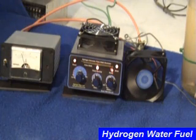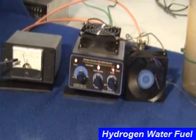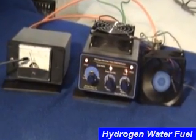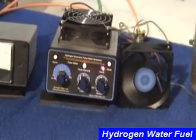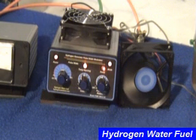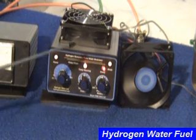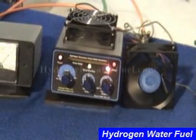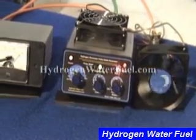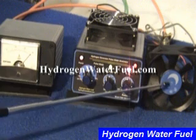The temperature light is activated — it has turned red. The amperage is cut back to about 8 amps where we set it, and the fan is activated, which means the 12 volts applied to the back of the unit is turned on. When the unit cools down, the unit will go back into the normal operating mode. The temperature light will turn green, the amperage will return back up to 30 amps for the normal operating temperature, and the 12-volt DC which was applied will turn off.